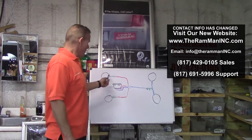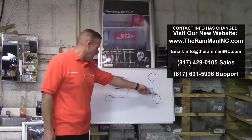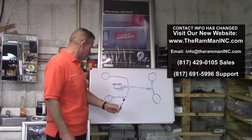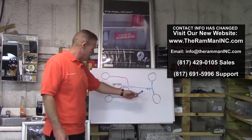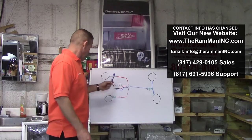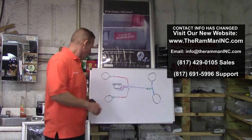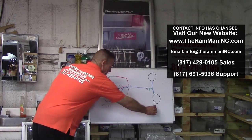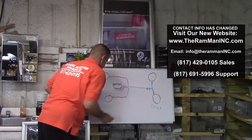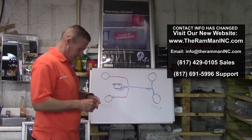We've got our normal brake system right here, typically like an old Mopar. There's our four wheels, here's our master cylinder, there's our brake valve, these green squigglies are our rubber hoses. We're going to assume that this is a disc-drum car — disc in the front, drum in the rear. We've got calipers here, and we've got wheel cylinders there.